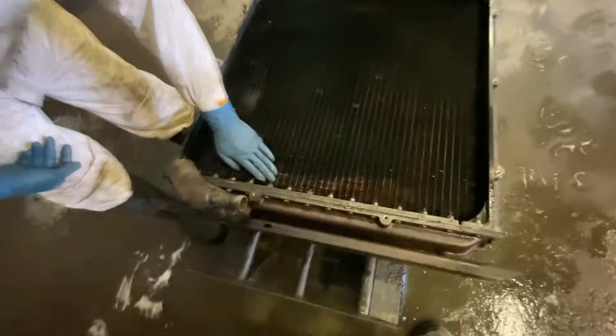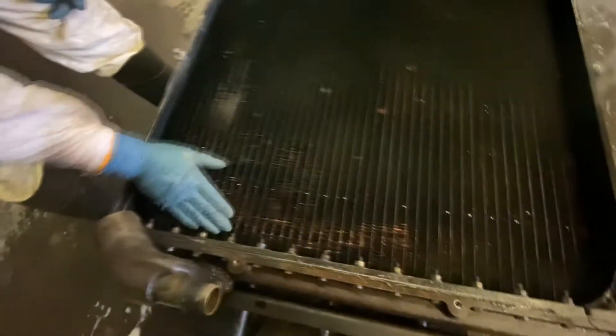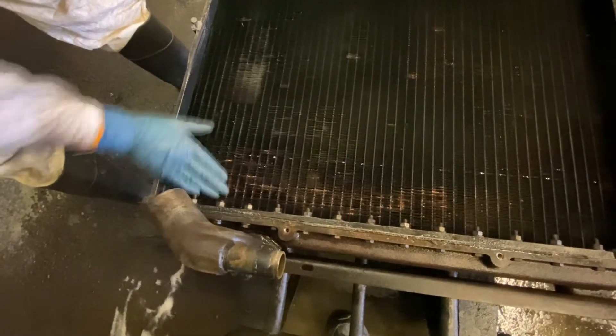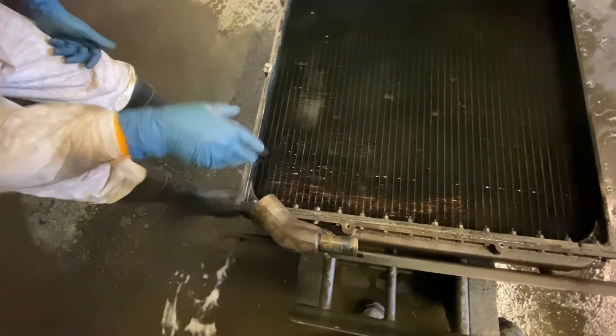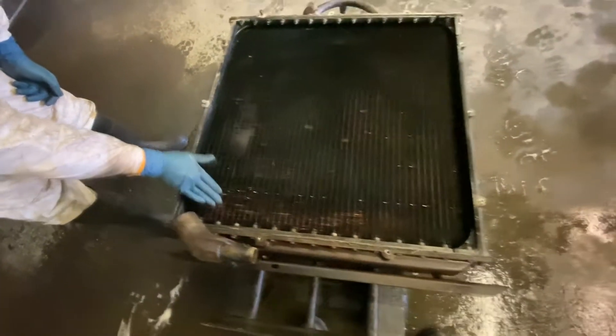See this one right here — there's a lower leak right here. Soon as the fan starts blowing, these guys bend the fins like this, and then they never go through to the other side. They're all blocked. All right, I'm for a new core if we can get more cooling out of it.